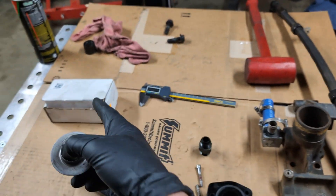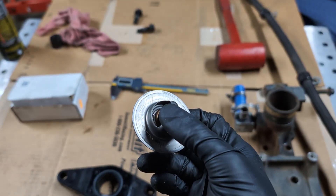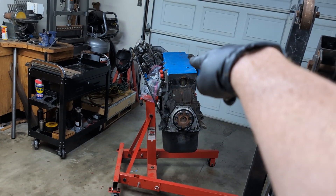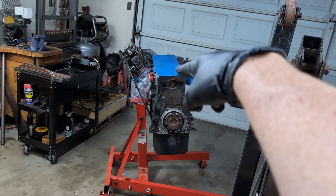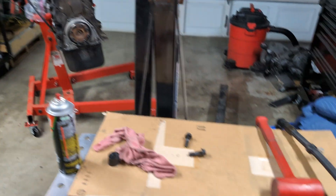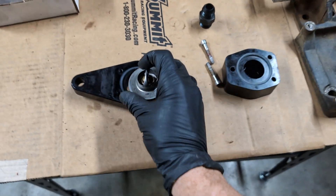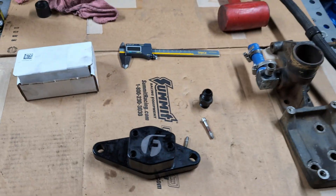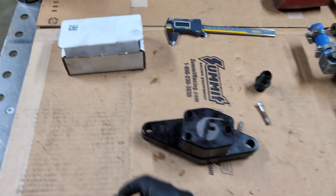In the service kit, they feature two thermostats. I don't know why they did that in the design. The 12-valve at least doesn't use this anywhere, because the front of that engine on all 12-valves is going to use a 63-millimeter diameter thermostat — so it's not like it's used anywhere else. But the design is simple: thermostat goes in there, sandwiched in. The quality and design, you can't beat it.